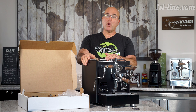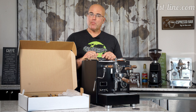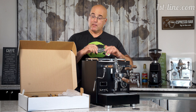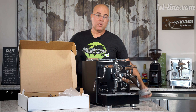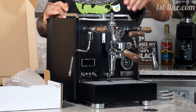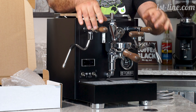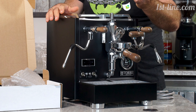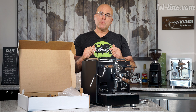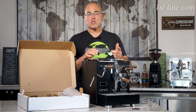This is a dual boiler machine created for those who are budget-minded. What do we mean by budget-minded? You want a nice dual boiler with the ability to use a tank or direct plumb, a rotary vane pump, E61 group head with the Torre ergonomic lever, commercial grade valves and wands with joysticks, and a PID controller on the coffee boiler. To get the price down, there is no PID controller on the steam boiler, but a small pressure stat to control the steam.